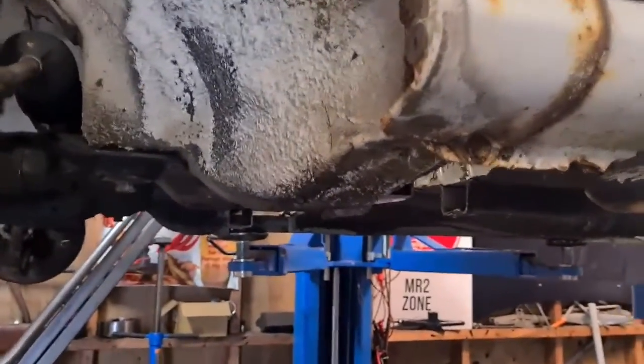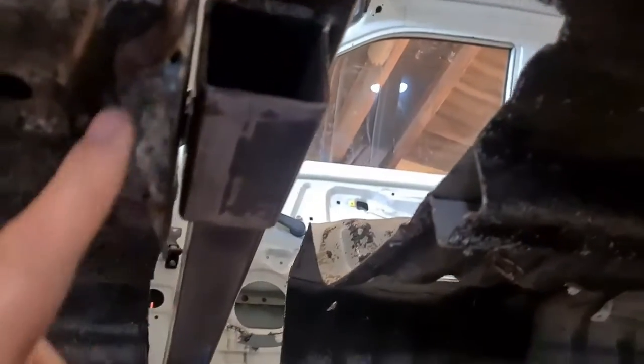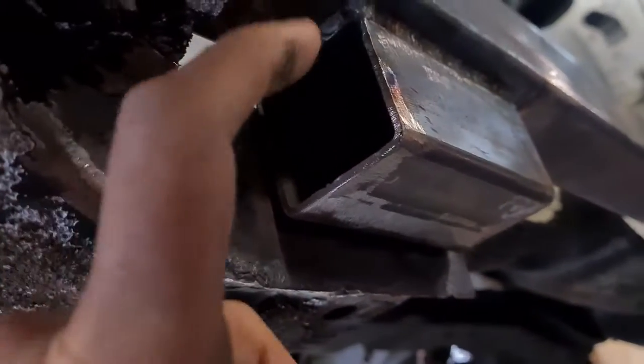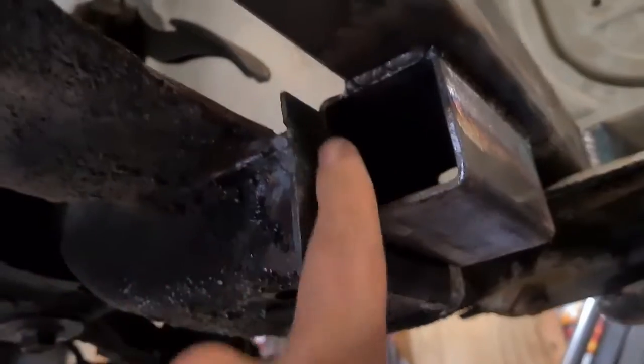So here, there's a good bit of structure in the unibody, where the subframe mounts to, and it did come down with sort of like a rail here, so I've cut that off, and I've used the bulk of it here, cut that whole section out so I can get to everything, and I'll just plate it on the unibody right here, and try not to burn through it because I'm only using TIG at the moment, and then built the structure. At the moment this is not fixed because I'm pulling things in and out still, but it will be welded around here when I'm done, and the same on this side.